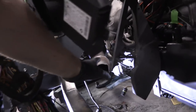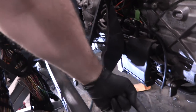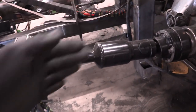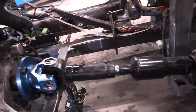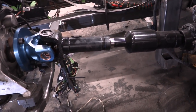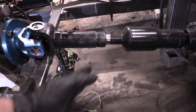Let me give you an outline of what we're going to build. It's going to come straight from the exhaust manifold down and underneath. Once we get there we're going into an X-pipe that lives right around the middle. X-pipes theoretically improve performance because as one cylinder bank is firing and shooting across, it creates a venturi suction from the other end that helps pull the exhaust from the other bank as it fires. This car actually has one stock, so we wanted to build one — we'll hand-build one and show you that tomorrow.